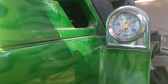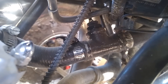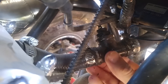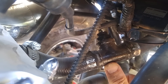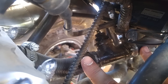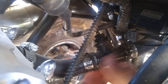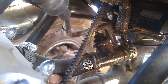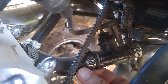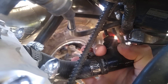Normally I don't see it go that high unless I'm doing intensive back-to-back drag racing, digging in hard in snow or mud. But under most riding conditions or just sitting at idle, even in northern California 110-degree summer weather, I don't seem to have a problem with temperatures. On the other end of the cable you can see where it screws in here on this three-way tee. This is a metal three-way tee I picked up at the hardware store with threaded nipples on each side, screwed in nice and tight so they're waterproof. My hose is split and connected on each side with hose clamps — one side goes to the head and the other goes to the radiator.